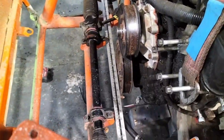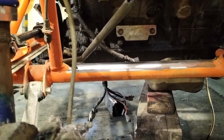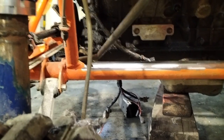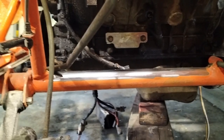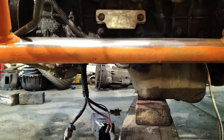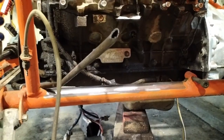The engine is in its final position. The distance between the rack and sump is good because I will have to put a crank position sensor on there. I've levelled the base of the block where the sump bolts to the level of a metre rule across the front - done that by eye, and I can adjust it at a later date. I've set the engine as low as it will physically go. Should I need to elevate it slightly when the engine mountings go in, I can do that with spacer washers. It sits beautifully with the engine mounts I made - straight mounts built out from the chassis and out from the block. I'm going to start getting on with that now - I need to cut some steel, there's a lot of angle grinding involved.